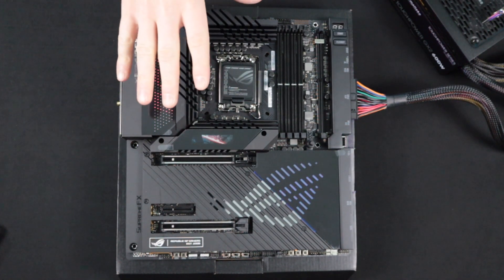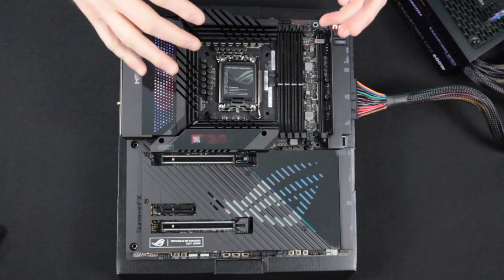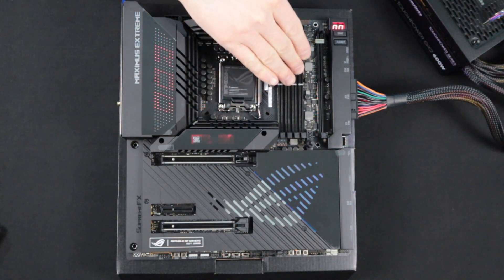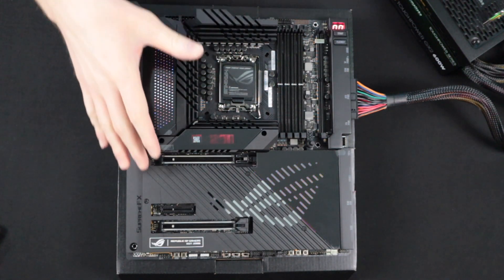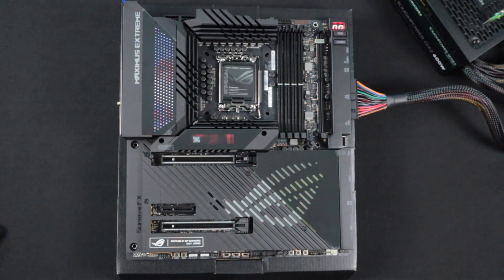The next thing you're going to do is push the start button on your motherboard. All of these indications are showing that this motherboard is working as intended — it's recognizing no CPU, no RAM, and it is operating as it should normally. This is, as far as we can tell, a motherboard that is not dead on arrival. This motherboard was successfully bench tested, and these are steps that you should take on any motherboard as soon as it arrives.